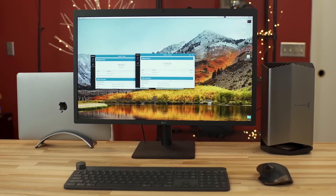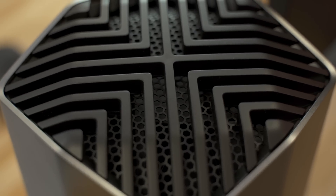The eGPU unit has an RX 580 graphics card — the best graphics card available built into the iMac — but you cannot swap it out. The alternative unit I've linked in the description lets you upgrade the card later, which helps with resale value and longevity. You'll probably get two to three years out of the BlackMagic unit before wanting to upgrade. One big benefit though: it is whisper quiet. It reminds me of the cylindrical Mac Pro — one large fan draws air in at the bottom and exhausts out the top. You cannot hear it over standard room noise, unlike other enclosures that have multiple loud fans.